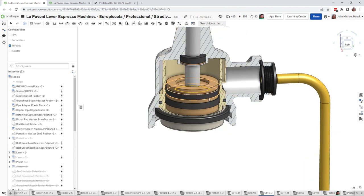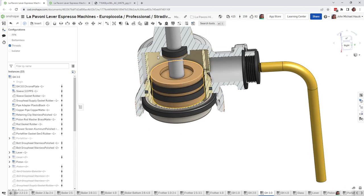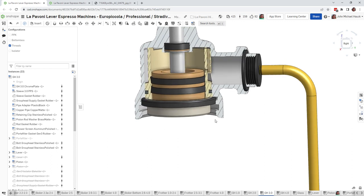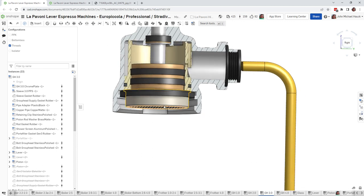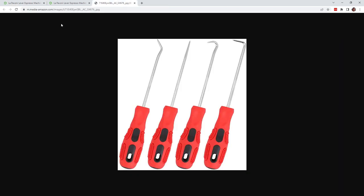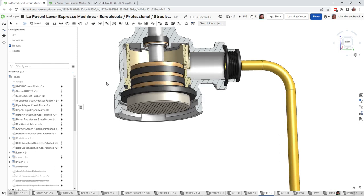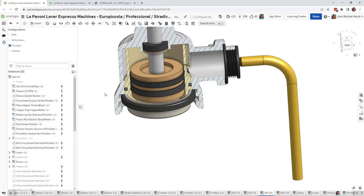But also, before you put it back together, you may want to get some food safe, high temperature lubricant. Comes in a little tube. You can find that at coffee supply places as well. Maybe give that a little dab and maybe wipe down the inside of the group head if there's any debris in there. Shouldn't be too dirty. And then you put the shower screen in, and then you jam this gasket in, and you can say, well, John, you just destroyed it with this nice little red-handled pick. I've put them back in many, many times and not had a problem, so stabbing them doesn't make them unusable.